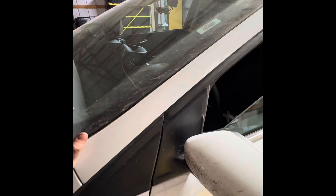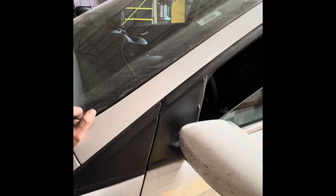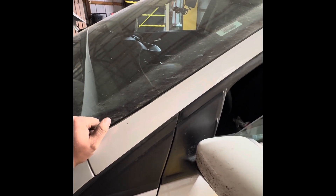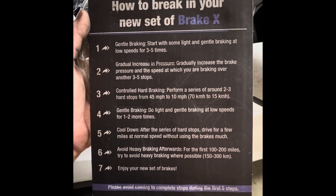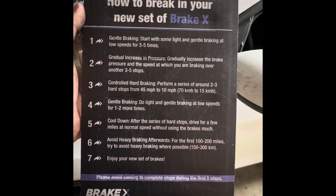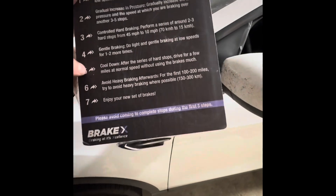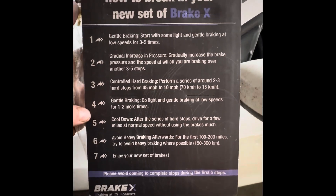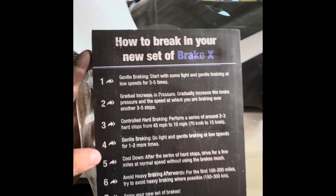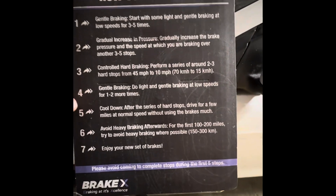After you get all this finished, you need to make sure and pump your brakes up a few times all the way to the floor after you start the vehicle. Whenever you drive it, drive nice and slow. This is what the parts manufacturer recommends for the bed-in procedure - I'll hold this here for your screenshot. Honestly what I used to do is just drive and do a gentle, gradual brake, which sounds pretty similar. Thank you - like, subscribe, leave a comment, tell me what I did wrong or what you did better, any ideas for next time. You guys have a good day.